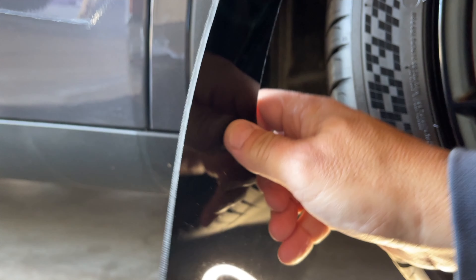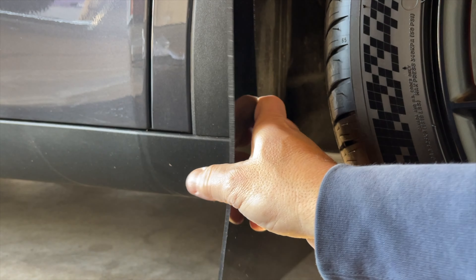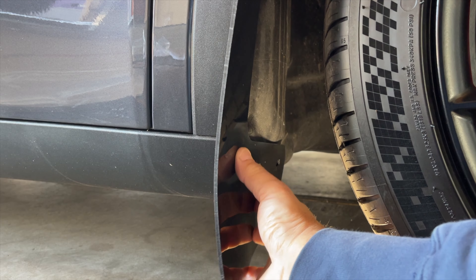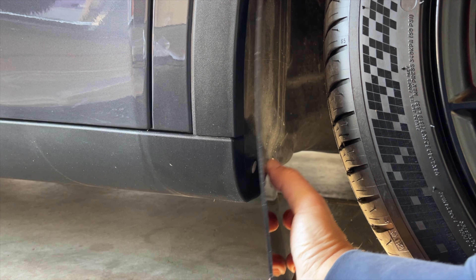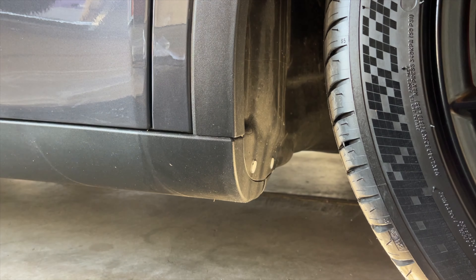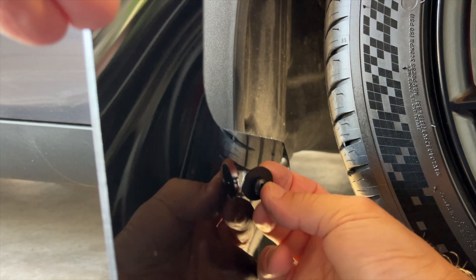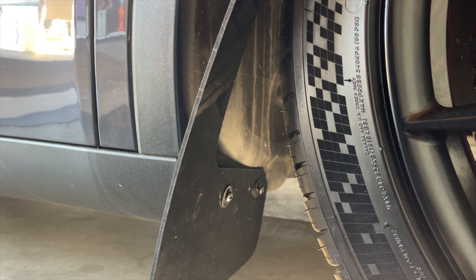What you're going to do is take the logo, place it to the rear of the vehicle, then line up here and get just two screws started into those white grommets that we inserted. It's a screw and a washer — put that through here. It's kind of a tight space.